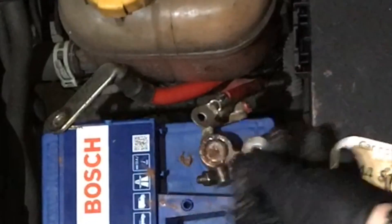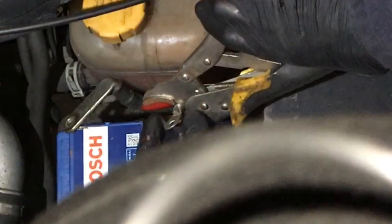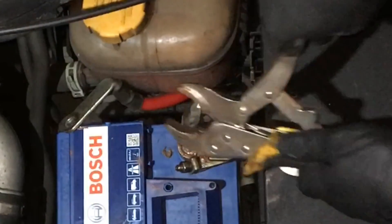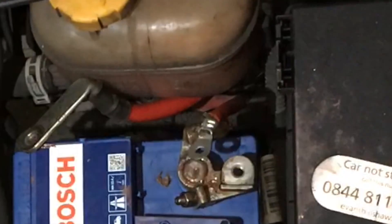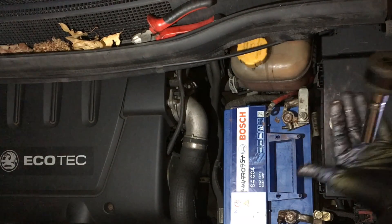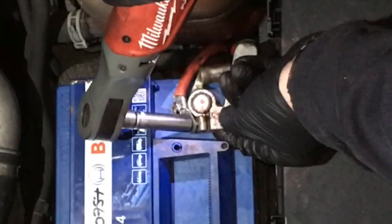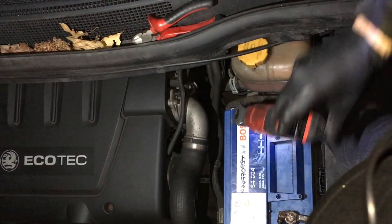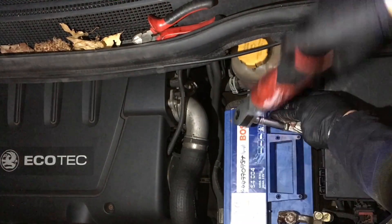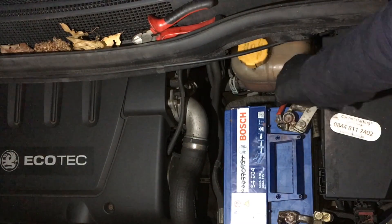Because it's quite a thick wire, my crimping tool won't go small enough, so I always use a pair of vice grips — shove it in the jaw, get it right in the jaw, and we can really crimp that up and really squeeze that down. You can get these crimp terminals off eBay. Now I'm taking that 10mm nut off the clamp, and that's where I'm going to bolt this — straight onto that battery terminal clamp on that 10mm nut. We'll torque that up nice and tight. We've got just enough wire there, and it fits on there like a glove — absolutely beautiful. Nip that up and it's attached really firmly to that battery.